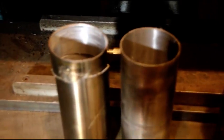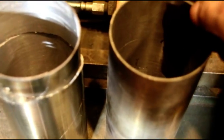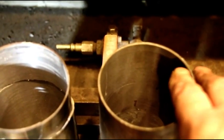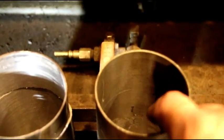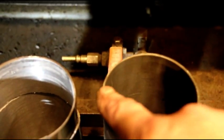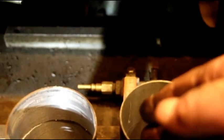Okay guys, got all the sleeves out of Travis's block. When I measure these, the side that's got the shadow in it has never been cut. When they originally put the sleeves in, this side is still 93 thousandths thick — they just tickled it with the cutter, and most of the bore was on the other side. It was actually crooked — it went down on an angle.